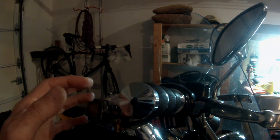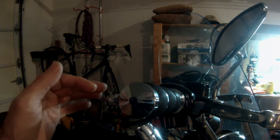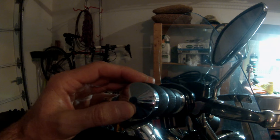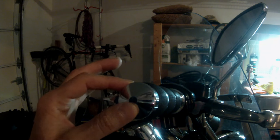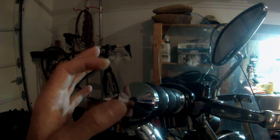Unless you've got debris in here, which you can blow out with an air can. Do not take this apart unless you really know what you're doing or have access to service documentation. These twist grip sensors — if you're having a potential defect — need to be replaced. There's a brake sensor in here you don't want to mess up, and there are specific steps like holding the lever over with a spacer when you disassemble. Do your research first.